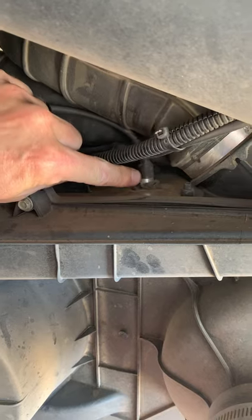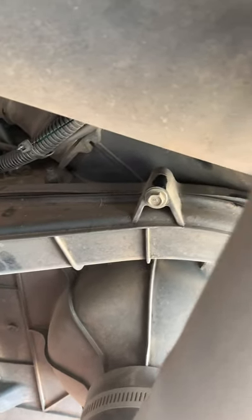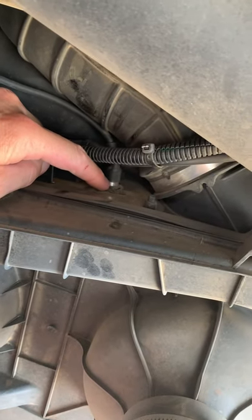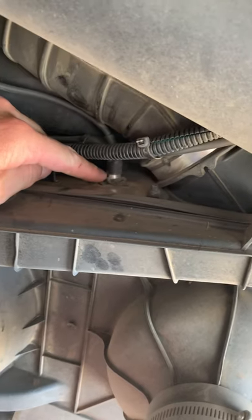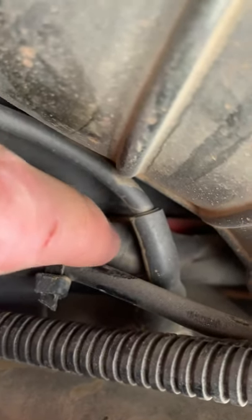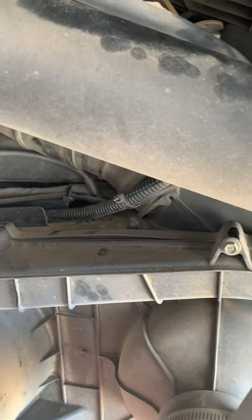What I did is I actually mounted mine directly over the belt. I moved this out of the way — there is my sensor right there. I removed the cover, removed my secondary clutch, and then I was able to drill straight up through it. I picked this location because there's a metal plate inside that will help keep it firm and it's easier to tighten. I also used some black RTV ultra black high-temp sealant, which blends in with the Razor itself. One caution: right behind where you're drilling is your main wiring harness — you don't want to hit that. Place something between that and where the drill bit is going to come up as you're drilling in from the bottom. I removed that secondary clutch so I could drill there rather than trying to get a drill into any other location from outside the housing.